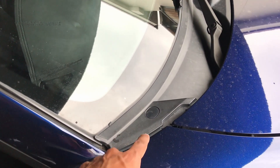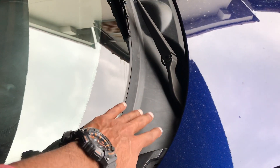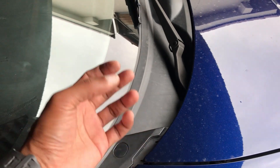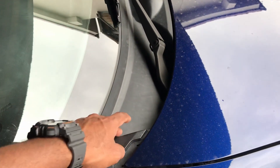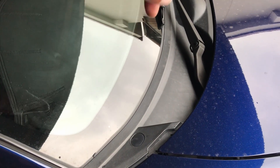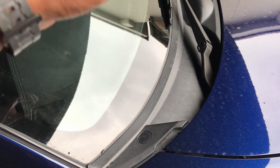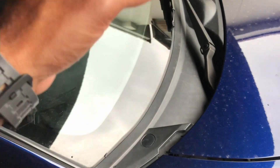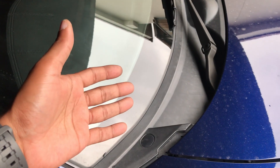The other place you're going to find leaks is right under this plastic trim piece. When you pull this off there are going to be a few bolts, and there's a plastic piece that fastens to the body panel underneath, where the bolt actually screws in. There's a rubber gasket around that plastic piece which can degrade, and once it degrades it's going to allow water through.